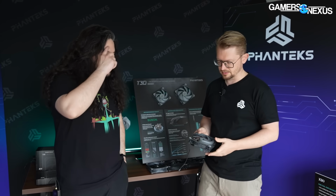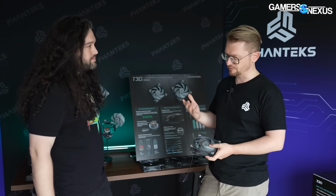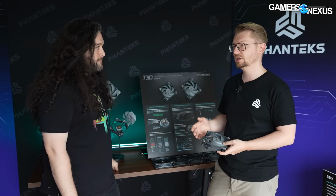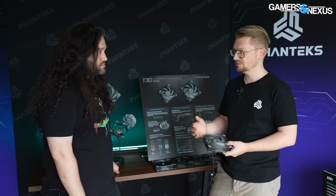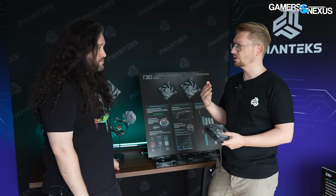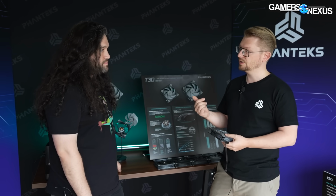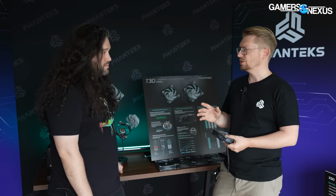Yeah, that's the thing. Usually things are more complex than just the numbers game. And the blade tip clearance in the premium performance fans is a common theme, right? And everybody tackles it a different way. One of the ways is using LCP. That gives you a big boost. And then it's about tolerances, the tooling, how stable and reliably can you produce it, right? Because there's a lot of factors like tooling wear and maintenance, and those are big challenges for us.